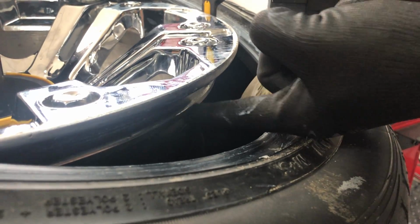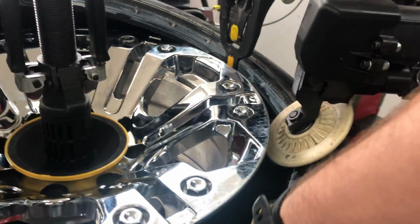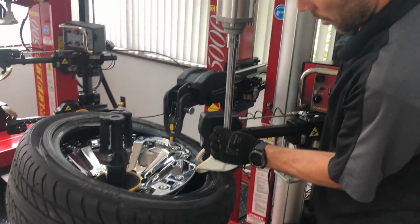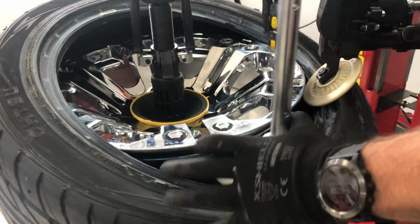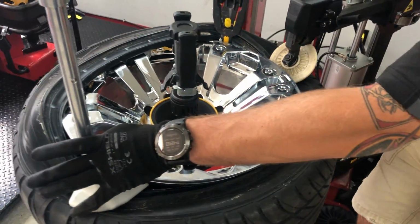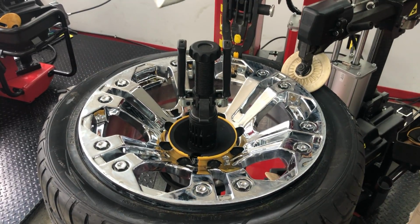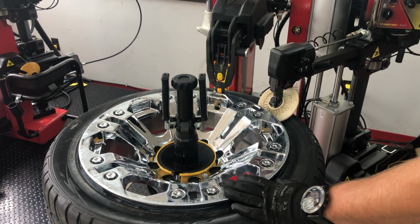So that's usually how deep you go, depending on the drop center. Then if it's a soft tire, you can always use your hand to push it down. But you have this wonderful device, which is the BPT, bead pressing tool. That is basically an extra guy there, ready to help. As you can see, with the old system, the tire slides in. We have 3 different points, none of them in contact with our wheel. No effort. I've done all this in first speed, just so you could see the whole operation.